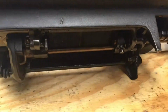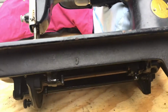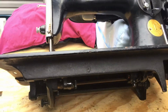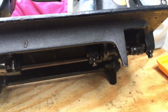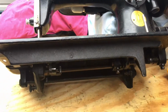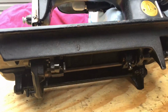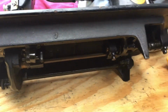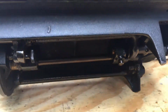So I did that and I let it sit overnight, and now you can see she's moving more freely. The machine still has some cleaning to do. We're nowhere near getting ready to crank this machine up and plug her in. But once you are, as long as the machine is not too stiff, because you don't want to overly tax your motor, you've given the machine time to loosen up with one of these unfreezing products, as I call them, basically products like WD-40. They're called dispersants, but they basically help to loosen up old oil.